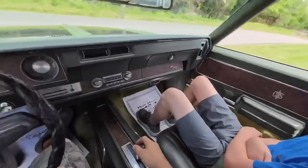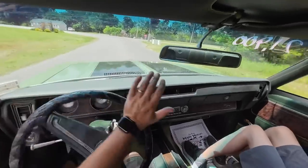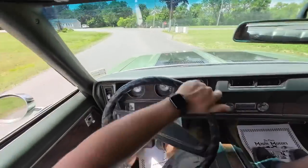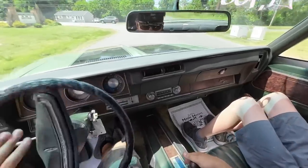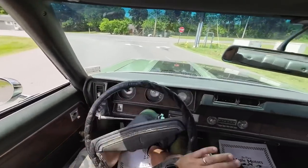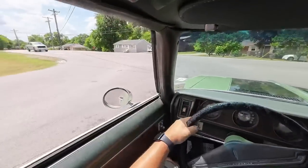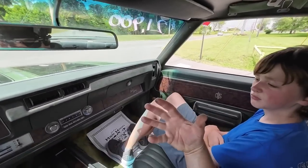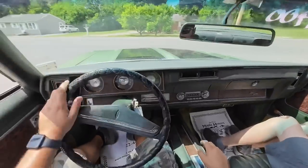If you turn the wheel all the way one way, I don't know which way it was. Nope, not that way. Go the other way. Nobody's behind us. That tire rubs. You hear that? Not that way, all the way. So that way. Okay. So, oversized tires, aftermarket rims. You know what that causes? A lot of times, you're going to get a rub in your fender from them.